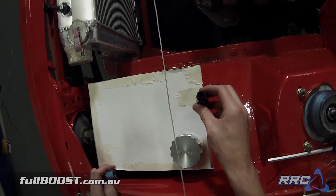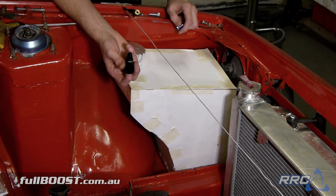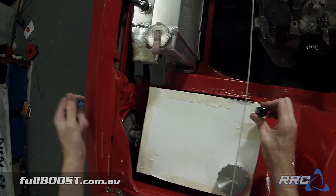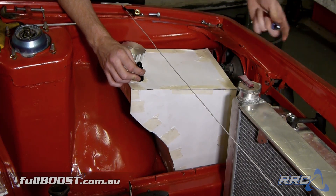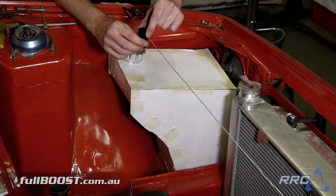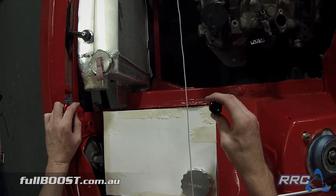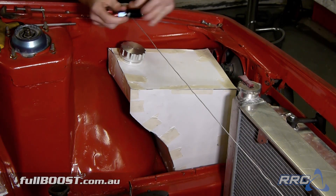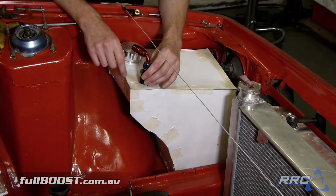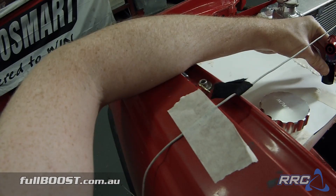One of the other things we had to make room for is this rollover vent. What this is, is basically a fitting with a stainless steel ball in it. When it's upright, the stainless steel ball sits in a little circuit and lets air pass it so that the tank can breathe. In the case of the car rolling over, to ensure that no fuel comes out — when the car is upside down, that ball sits on a machined surface and basically seals out any pressure of fluid trying to force its way past it, which means nothing can get out in the event of a rollover. The fitting will go on top here — we've got a fitting welded on there and we've got this screwed on. You can see there's definitely enough room, so we won't have any clearance issues.